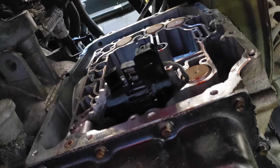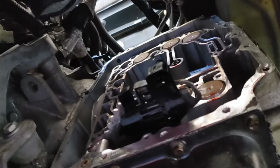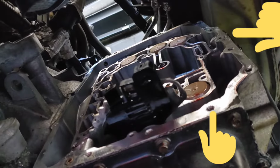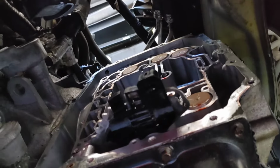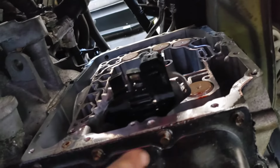As you see, I went ahead and popped it off right there, and you don't see any tubes right there because I didn't hold mine with needle nose. I actually made it harder on myself, but I'm letting you guys know so you don't make it harder on yourselves. Do take all that old gasket off. You do want the mating surface to be great when you put the cover back on, as always. And don't get any of that stuff in your actual transmission fluid, because right at the bottom of that solenoid mating surface is your transmission fluid, and you don't want a bunch of gunk just sitting in there.